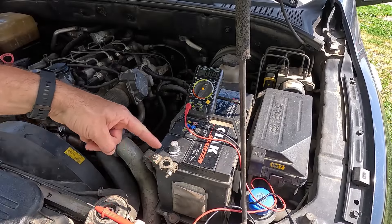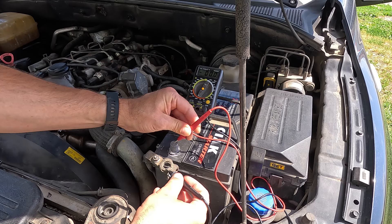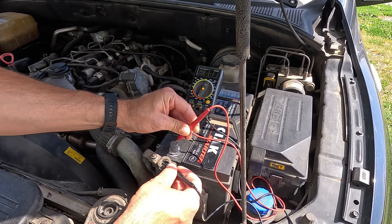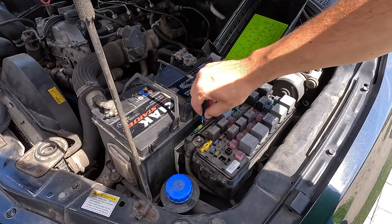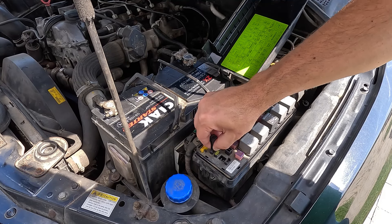But what if both the battery and alternator voltages are okay, yet the battery still keeps going flat after the car is left parked for a day or two? Well, in that case, we'll have to do a parasitic drain test, which should reveal if any device is using more electricity than it should. This is done by disconnecting the negative battery lead and hooking up the multimeter in line. Make sure everything in the car — lights, radio, and so on — is turned off, switch to amps using the rotary knob, and check the readings. If this is more than 50 or 100 milliamps, then something is draining the battery. To figure out what, locate the fuse box and start pulling out the fuses one by one until the amperage drops. When this happens, you have found the culprit.